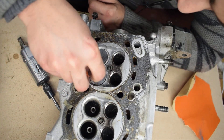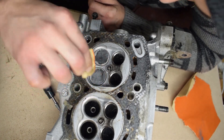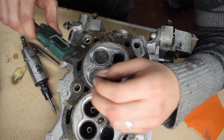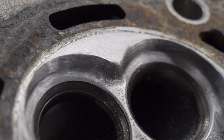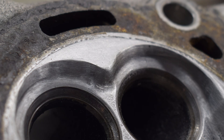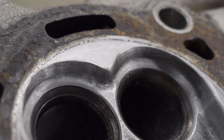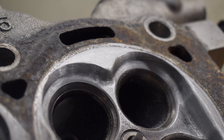There's also a high chance that in the second stage of my build I will downgrade to a small, very fast response turbo, as I think that low and mid RPM play a critical role in the real world. Here you can see the before and the after of the area around the intake valves. I have not dramatically changed the shape of the combustion chamber, but simply made the original anatomy a bit more performance oriented. Although I don't have a flow bench and can't prove my theory, I'm pretty confident that even this much will negatively impact my low and mid RPMs to some degree, but I must sacrifice a bit of low RPM in the interest of power.